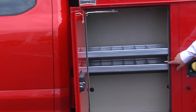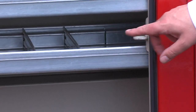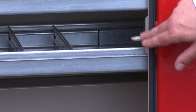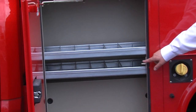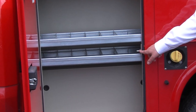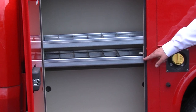They come with a full D-ring striker on the door. Many competing units have just a post. The advantage of the D-ring striker is that when the door closes, the latch will fully enclose over it, making it much more difficult to break into the utility body. This is also adjustable, so over time if the door loosens a little bit, you can use a wrench and pull that D-ring back, making the door seal tighter and keeping your contents dry.